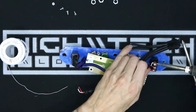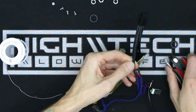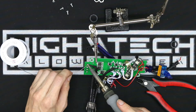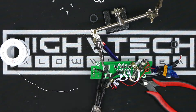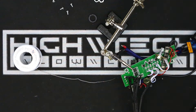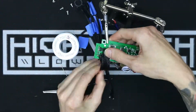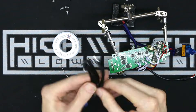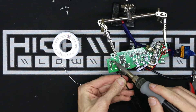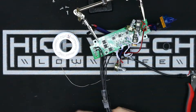Now we're starting to get progress and things are looking cleaner. I did test it on the bike and there are some things I want to change — I didn't like how the six-pin wires were coming out the back of the dashboard. They ended up hitting the forks when coming straight out the back, so I wanted them to route down under. I was completely fighting with the sleeving the whole time; it was making it really hard to do those sharp bends. So I said screw it — I'm just taking off the stupid sleeving. Once I did that, these wires were much easier to work with.